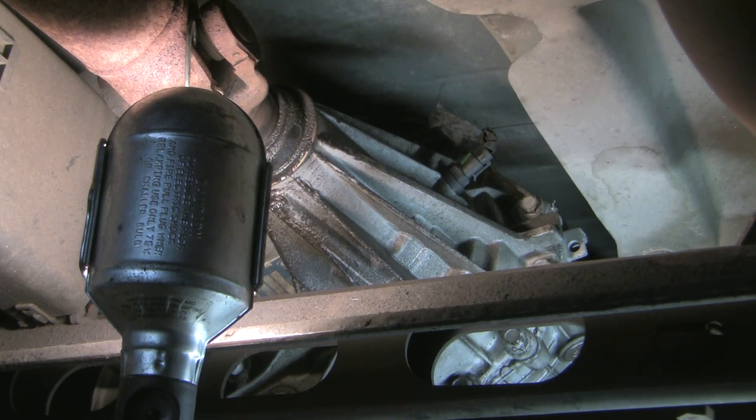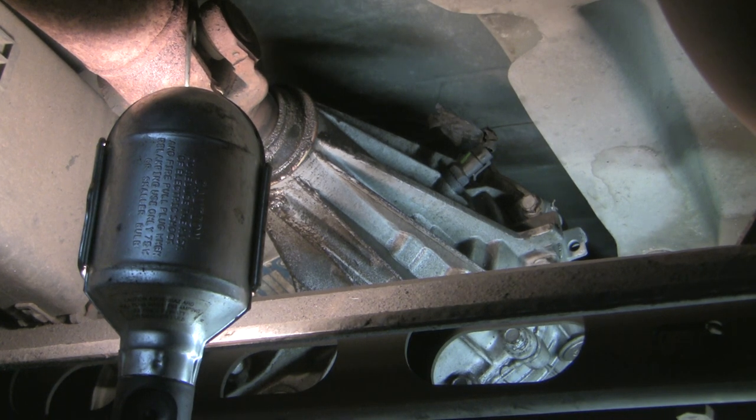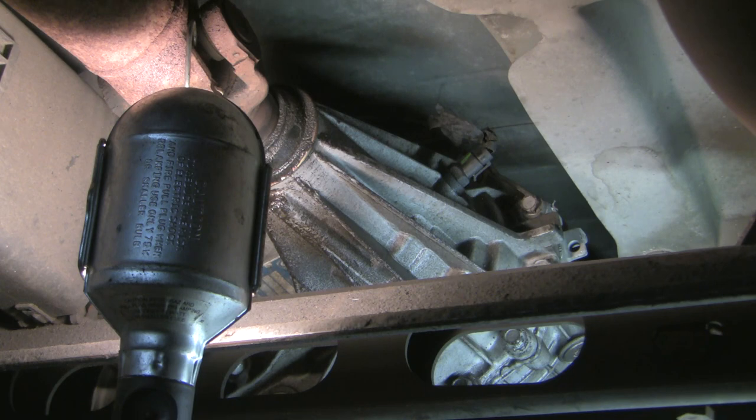I've got you in the rear of the vehicle looking forward. The trouble light is hanging on the rear driveline right there. Now this transfer case has three speed sensors. The rear prop shaft speed sensor is there on the right — that one seems to be working normally. It's got a vehicle speed sensor on the opposite side, and it's got the front prop shaft speed sensor that we took out earlier. My plan today is to swap out the rear and the front if possible, to see if the problem switches to the rear — to verify that it's indeed a problem with my sensor before I go out and buy one. I've got some time today, so rather than just swapping the sensors out, I'm going to actually plot out the waveforms on my scope to compare the good with the bad, to be used as a benchmark in the future.